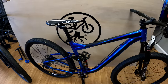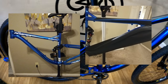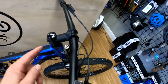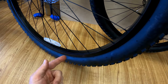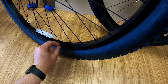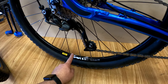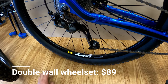Here's the bike that I created. I stripped it down to the frame, took everything off, and upgraded a whole bunch of stuff. What's original to the bike: the tires, the seat post with quick release, the grips, and the stem. A lot of inexpensive big-box bikes come with single-wall wheels — just a thin layer of aluminum — so they're not very strong, especially in big sizes. We have people come in all the time with these wheels that are just bent. Single-wall wheels had to go, so I bought some inexpensive double-wall rims off eBay for about 90 bucks.